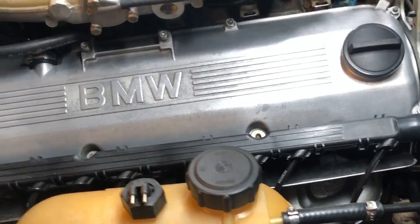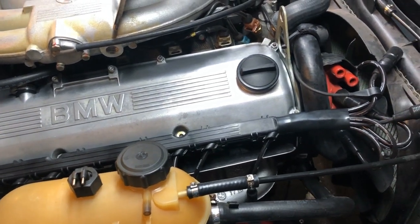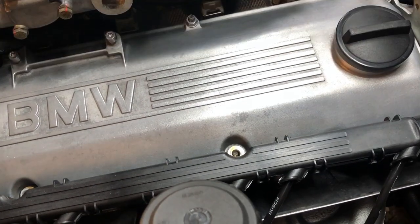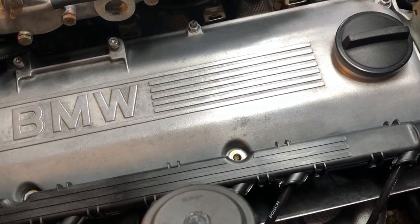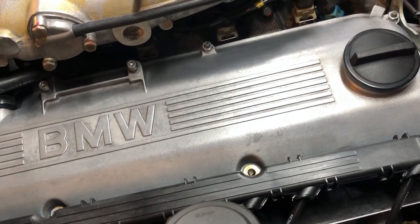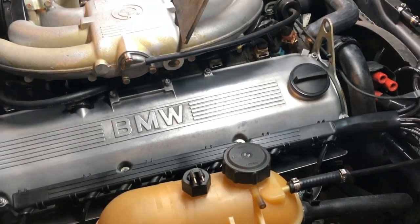See if we build pressure. I need to disconnect the fuel pump relay. Then we'll quickly install the oil filter and top off the oil. I think we're almost ready to turn it over. I'm excited, but at the same time, a little worried. It's nerve-wracking a little bit, I guess, but I think it's going to be good. So yeah, let's continue here.